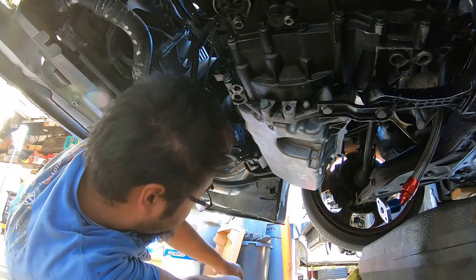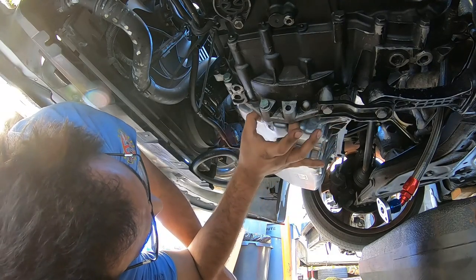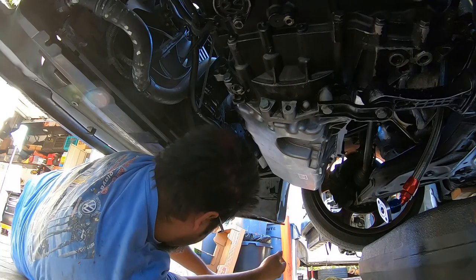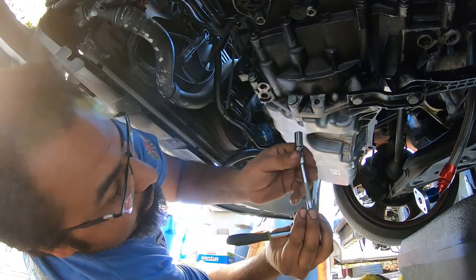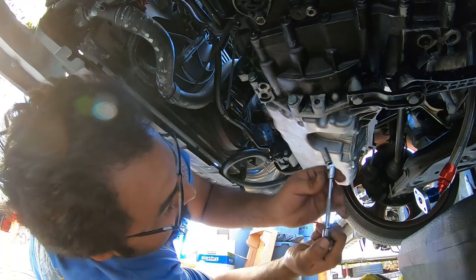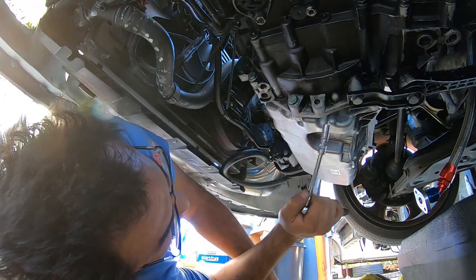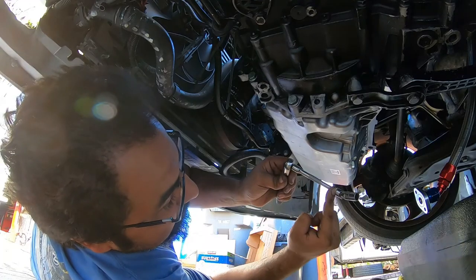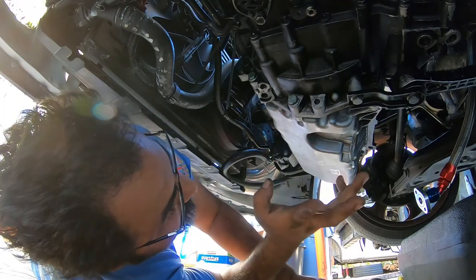So the way that we got the two really, really annoying bolts here, this one and this one over here, or these two, depends on which one's harder, depending on your setup. But these are really annoying. So I'm going to tell you guys a little secret here. Not really a secret, but use a quarter inch ratchet with a wobble head. That way you can get the two bolts to go on there. But remember to do it by hand and not with the ratchet, because if not, you're gonna cross thread it on the way in, and we don't want that to happen. So I did it with these two right here, and they went in smoothly by hand. That's it. And again, once you do that, get an adapter and torque spec these to 11 foot pounds. They're gonna be pretty hard, by the way. They're not gonna be easy to torque spec, so do the best you can.